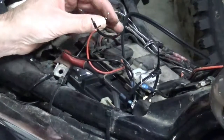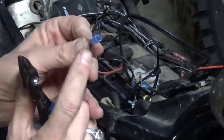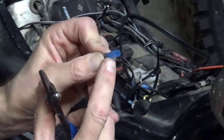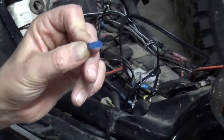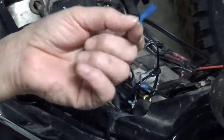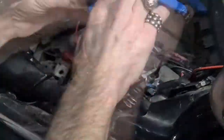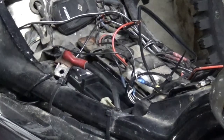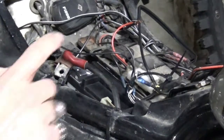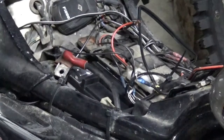Going a little bit longer on these leads is fine. Again, where you crimp them, right here, you get all that extra to kind of cover. You really don't want to get any of your brass or copper out near the end. Again, this is to protect it and hold everything together. If I had red shrink tubing, I would use that again so I would know it's positive, but I know with that one red lead, it's going to indicate that. That's my positive lead.